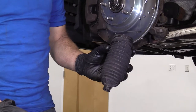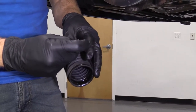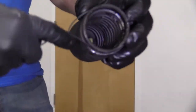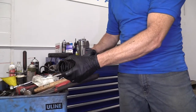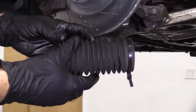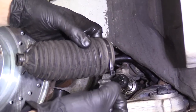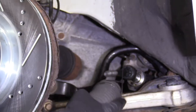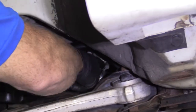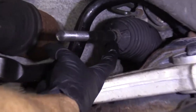We're going to take our power steering bellows boot and bring it so it's almost all the way down but still plenty loose. We'll cut off a little bit of extra because we don't need a whole bunch flapping off. Now I'm going to slide this onto the power steering rack. Once we know it's all the way on, we'll grab this, pull our wire tie nice and tight, and then trim off the excess. After that, we'll continue on to the outer clamp.